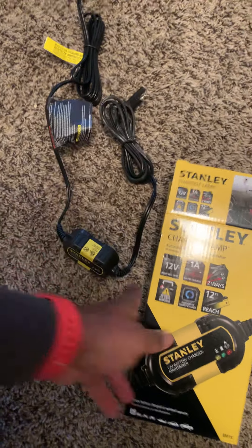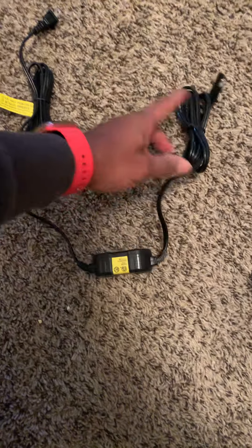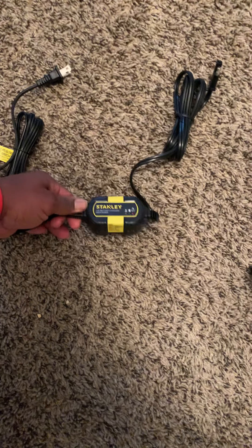To keep your battery fully charged, I think you should charge it every three days, especially when you're not riding. If you're riding you're probably good, but if it's raining for a few days and you're not riding, the best thing to do is keep your battery charged with a battery maintainer.